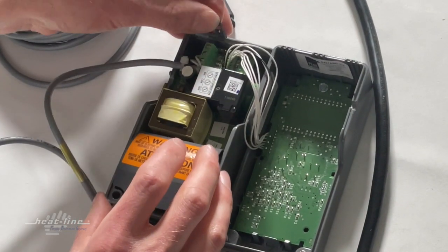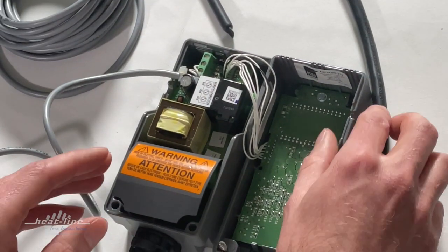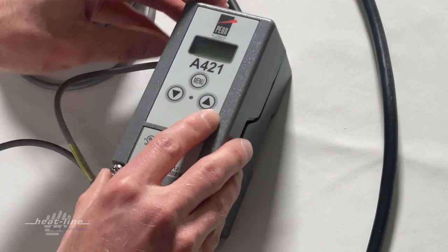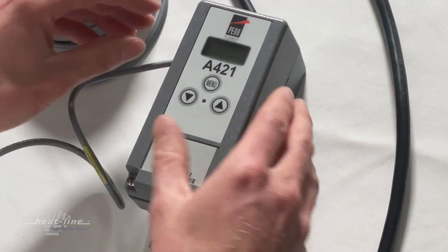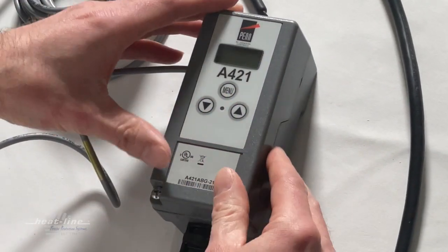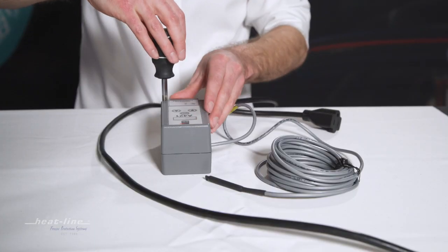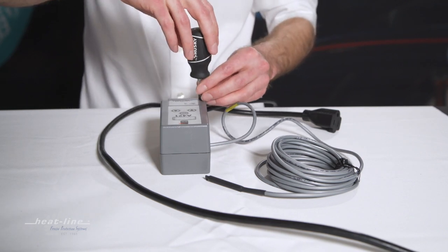To unlock, we're going to place the jumper onto the two pins. With that completed, we're going to put the face plate back on so we can then bring power back into the unit. There are just a couple of tabs in the front — press them in, make sure the sensor wire at the side is not being pinched, and then tighten the Phillips screws — snug, not too tight, just enough to hold the cover in place.